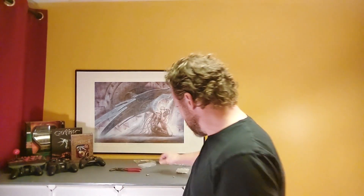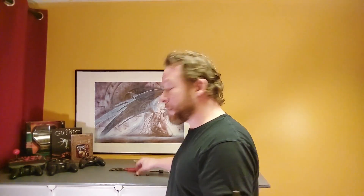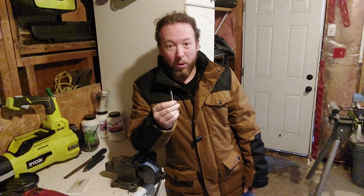However, this tap is not the proper tool for cutting a blind hole — a hole that doesn't go all the way through. I obviously can't thread all the way through because the top of the tap doesn't cut the right thread and you don't get far enough. What we ended up with at this point is: it fits, but it sticks out — and that's not acceptable. So I have to order another tool, but since this is such a high-quality precision piece of equipment, we are going to chop that off. In order to do that, we have to go to the garage.